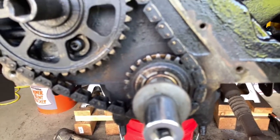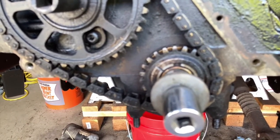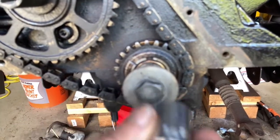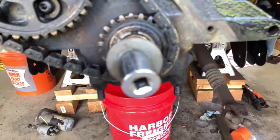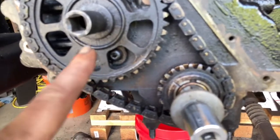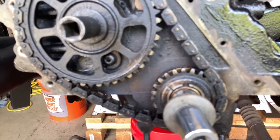Now, I'm not a big fan of impact wrenches. If you watch my channel, I don't go too crazy with them. But for this application, an impact wrench makes your life easier, because when you rotate with the crank bolt, which is 3/4 on mine, it should be 3/4 on yours, sometimes it gets a little bit tight. When you hit it with the impact wrench, you're not going to move your chain or your sprocket. Same thing with this one. I think that's 5/8. Hit that with the impact, it'll come out. That is your cam bolt.